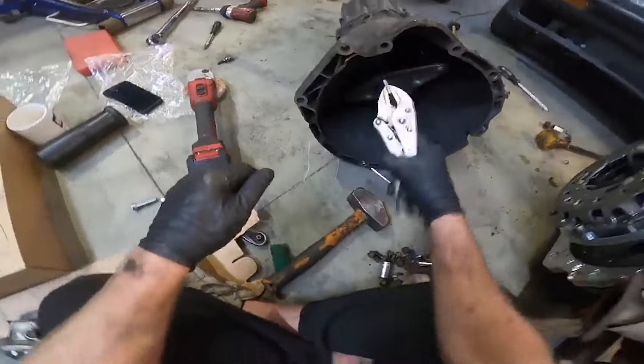With the manifold and steering knuckle issue fixed, the engine was going in for the final time soon, so I thought now would be a good time to do the timing belt. Before the engine went in, we also made all of the brake lines — all hard lines made ourselves, and braided line where the flexes go, made at a shop around the corner. We also installed the hydraulic handbrake and ran all the lines for the clutch with braided line as well.